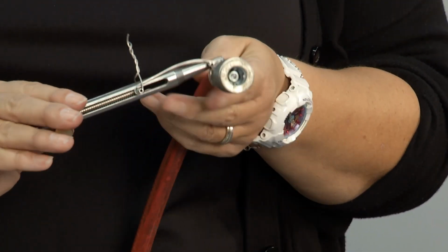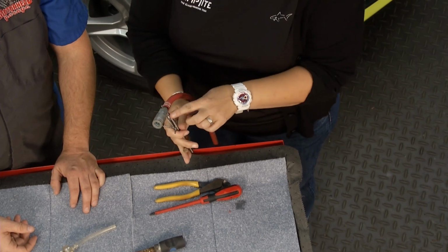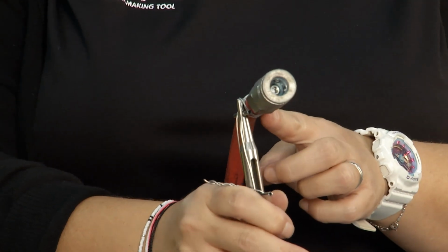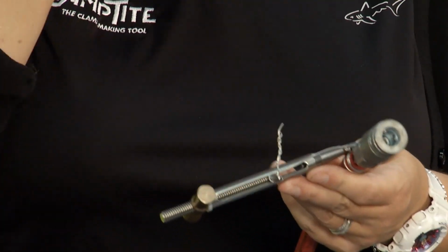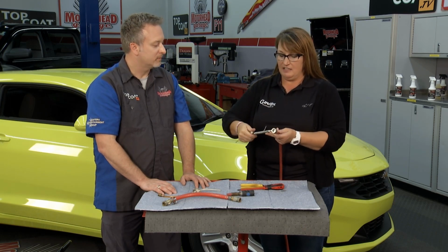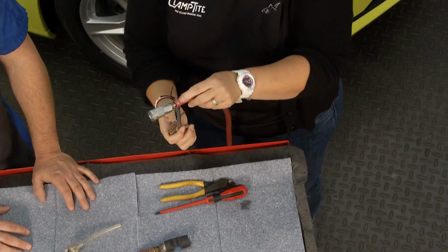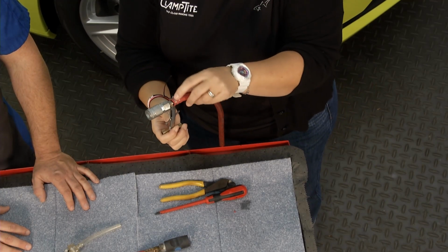Because there is pressure running through, just like Kevin did, you've got to loop it around twice. Yep, we've looped it around twice. We're not overlapped. That's a really important thing that we tell a lot of people, because air, water, fuel finds a way out no matter what. So we're just going to start tightening this down. You're going to feel it when it's getting tight too, and you're going to see it. See, it's already starting to bubble out. That's that barb sitting right in there.